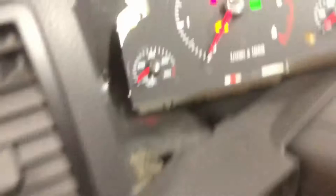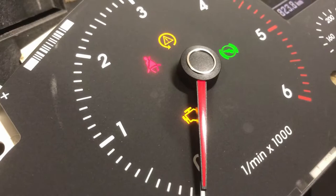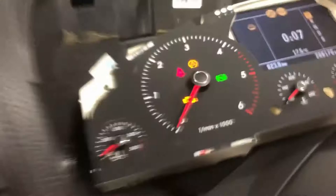So this is our issue. When we turn the lights on, you look at the needle, and if you use your dimmer switch — the dimmer seems to work. Your backlights should work as well, so I'm assuming they're all supposed to be tied into the same circuit, but the bulb for that portion doesn't seem to be working. I'm thinking I've got good power to it, so there's an issue with the lights or the circuit board.